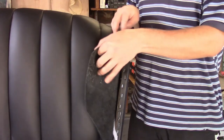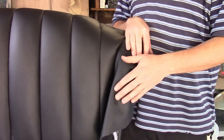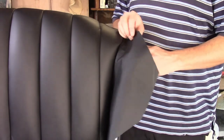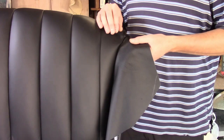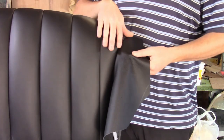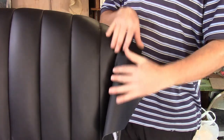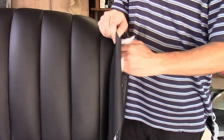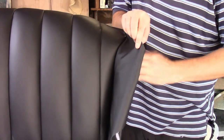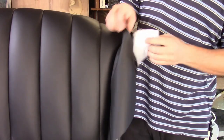Now there are these sides I have to finish. Normally these are padded and installed before the backrest, but I normally pad them after the backrest is installed, because I want to pad them in such a way that it looks like the backrest is just continuing over the side — like it's another pleat. You usually end up using a lot of padding in this, and it takes a while to fuss with to get it just right.